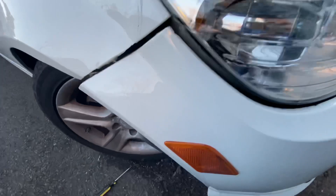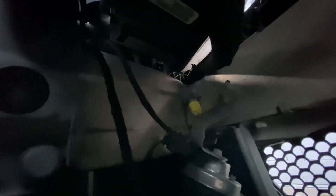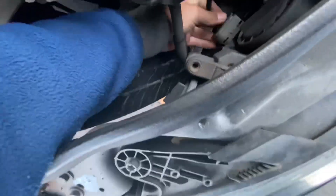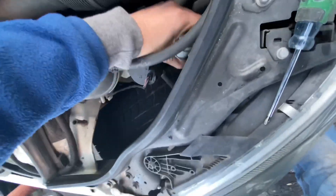All right, next up guys - get on your knees, you gotta reach the headlights. Use a flat head screwdriver. Let me show you guys right there - that headlight assembly right there. I had to put the screwdriver in and simply just pull it out. Good thing mine didn't come with a wheel well, I'm just gonna have to remove it. And then your headlight assembly pulls out and you'll be able to wire it.